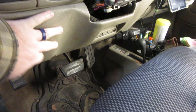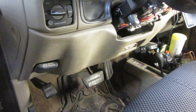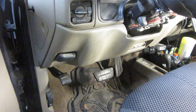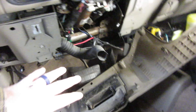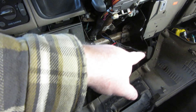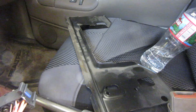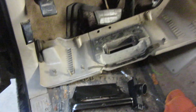The first thing we need to do is pull that off. I have a video on that in my playlist on the channel — go check that out to see how to take it off. We got this all torn apart. There were four 10mm screws holding that piece, and that metal piece under the dash comes out from underneath this piece. Then these right here were, I believe, 7mm.